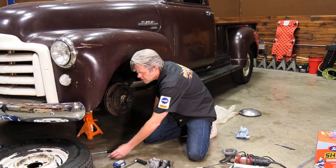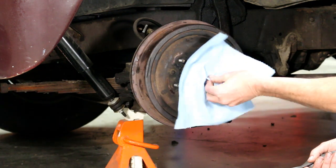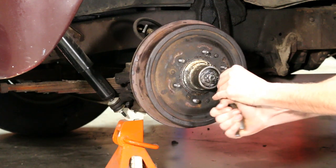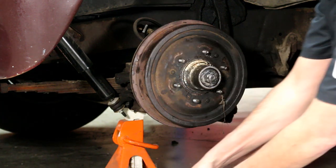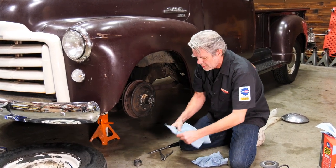We're going to pull our cup off right here. You're going to notice this large nut, and it is being held on by the cotter pin. You're just going to take that, bend it back, push it forward some, grab a hold of it, pull it forward and out, and put it in your cap so you can keep everything together nice and neat.